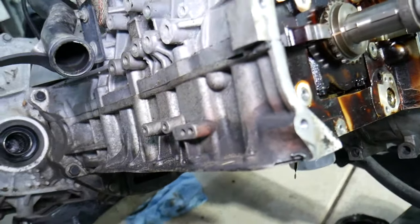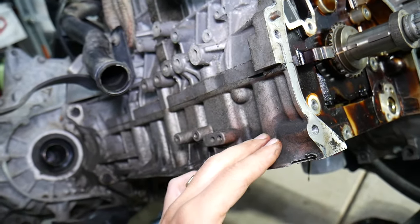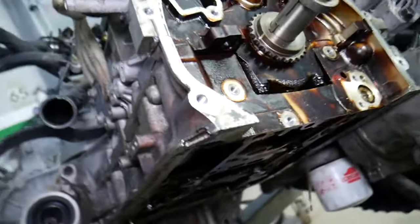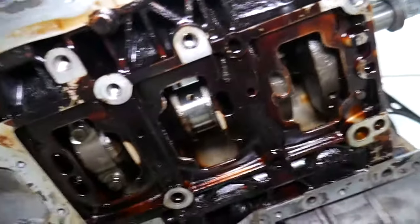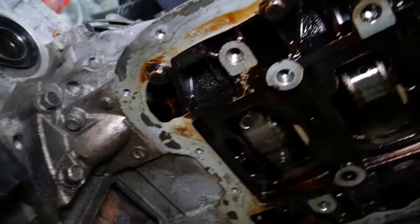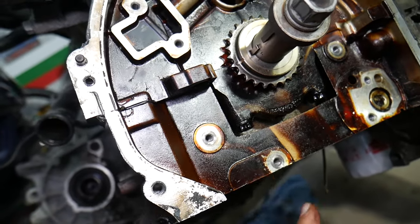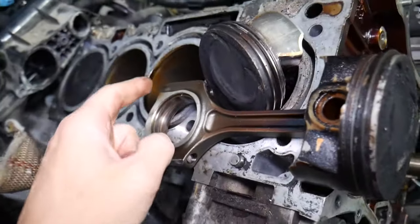But that's not even the worst part. Sometimes the engine block comes in two pieces — a lower crankcase and an upper engine block. You can see how the two separate right here. From the upper block we can access pistons for cylinders one, two, and three, but cylinder number four is hidden. You need to remove the lower crankcase to get to the connecting rod for cylinder four or the main bearings of the crankshaft — you simply cannot access them otherwise. It takes quite a bit of work.